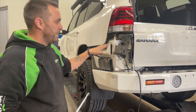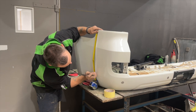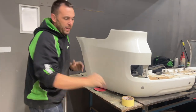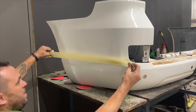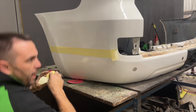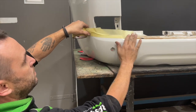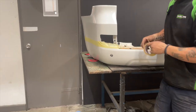Using the same reference point, come down 375mm, and where the intersection will be, it's 290mm again. It doesn't matter if we're a little bit either way — this is just to get it initially cut off and we're going to line the two up. Go about 10mm below the line. This does run slightly downhill then flat, so do the tape first, then come roughly 10mm to 12mm down — it will get cut again. That's your rough bumper cut, then straight through that line.